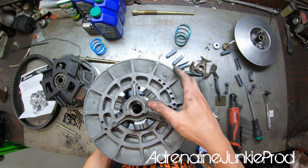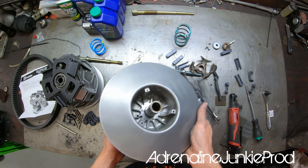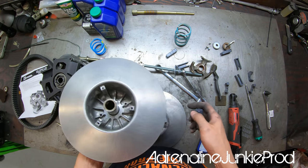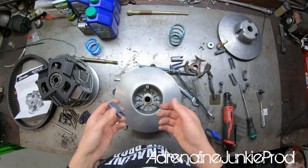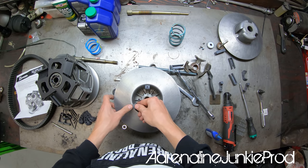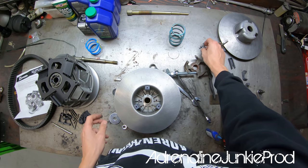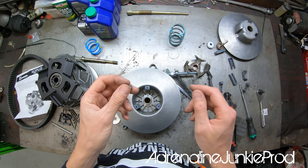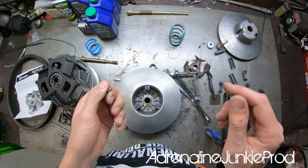The compression tool is out, everything is lined up, the Helix looks good, all bolted down nicely. Now the last step — install the new outer wear components, which are a nice tight fit and slide on firmly. Clean old Loctite off the bolts with a wire brush, apply blue Loctite, get the T25 bolts started lightly to avoid cross-threading, then snug them down. Do not over-torque these — the Loctite does the job.